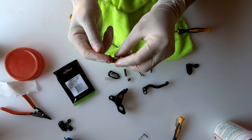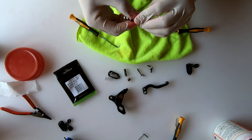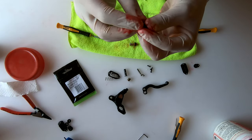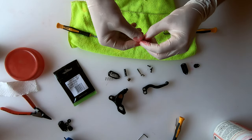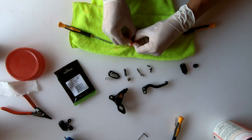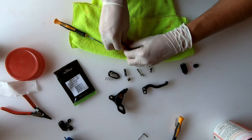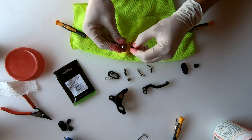I've pulled some grease off so I'll lather it up again. It's not necessary to go this heavy with the grease, but I'd rather have too much than too little. The secondary piston seal is a lot easier to fit — you can just fit it with your fingers. Remember it's important to put it on correctly so it faces away from the concave side. Both seals should face the same direction.